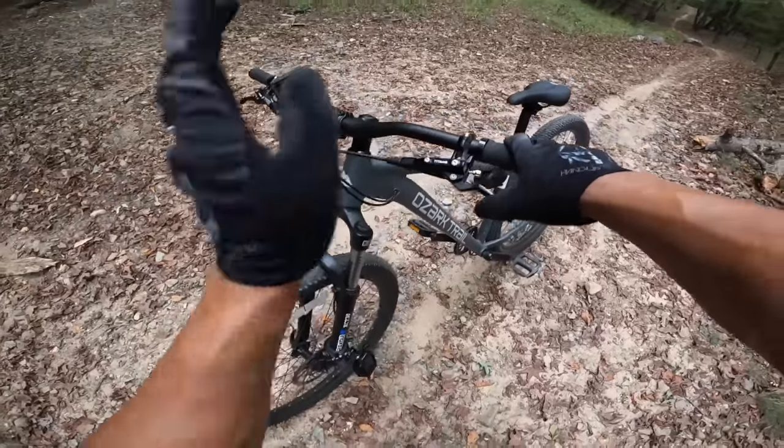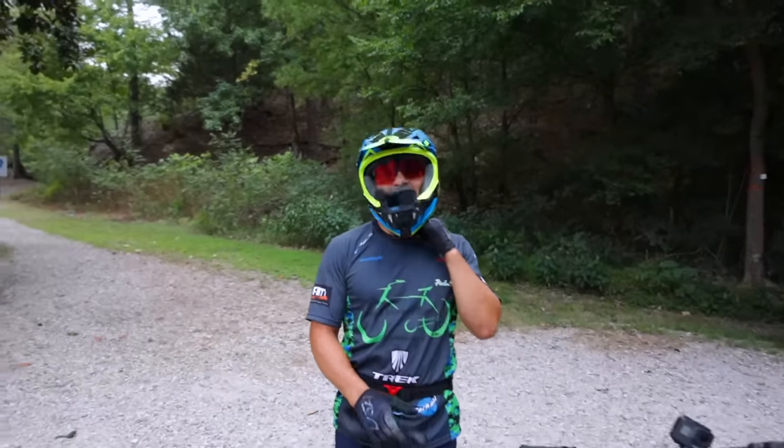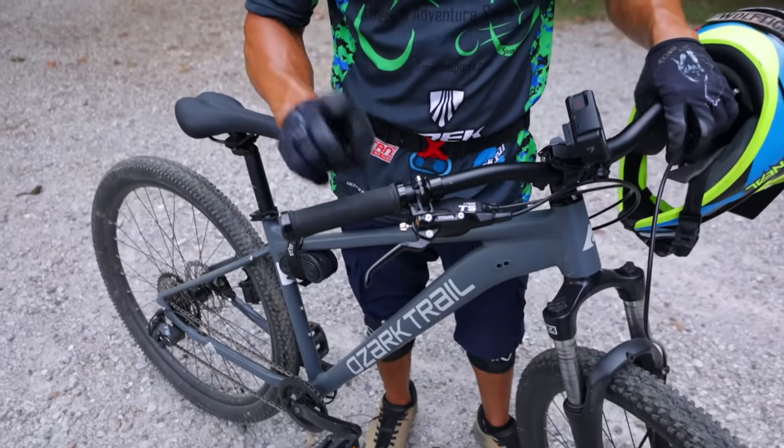That was the real-time review on the Titans four-piston hydraulic brakes. Not a letdown - they got better as it went. I think these things really have to be bedded in or sanded down on the rotors; it just takes a while for the pads to break in. The rear was acting the same as the front and then as we kept going they started acting better. On the four pistons I was able to do a one-finger stoppie at the end of Ragnarok. The levers are amazing - the reach adjustment is totally accessible right there.